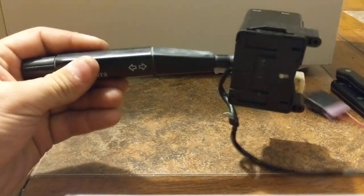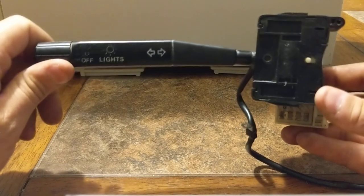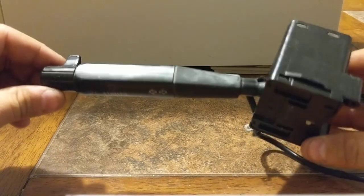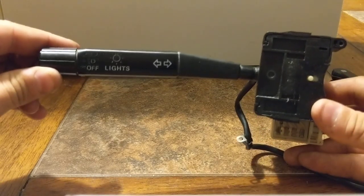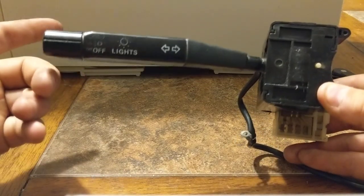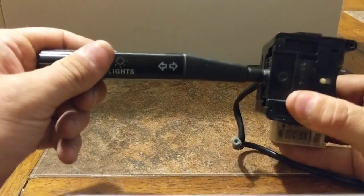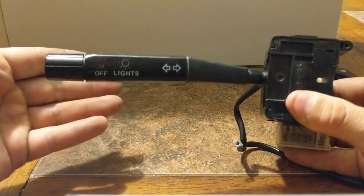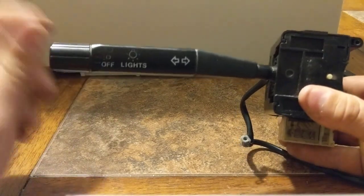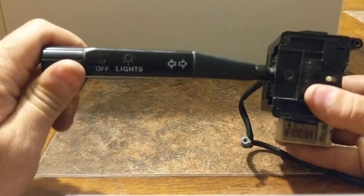What we have here is a light switch for a 1985 300ZX. We've got a little toggle switch - switch off to marker, and you can put on your regular lights, high beams, permanent, temporary, flashing. Mine was keeping the headlights on all the time, killing the battery.